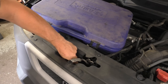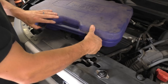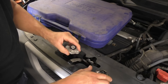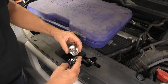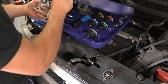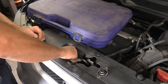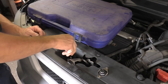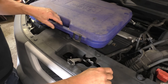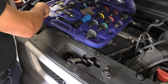The radiator cap hides right down here. Look at that little guy. We'll get the radiator cap out of our coolant testing kit — I think it's this one. Well, maybe it's a skinnier one. There we go, I think it's this fella here. We'll stick this down on the radiator. There we go. Now we can stick our rubber hose on here and hook it to our pressure transducer. I'll put this away, we'll get our scope set up, and we'll see what we capture.